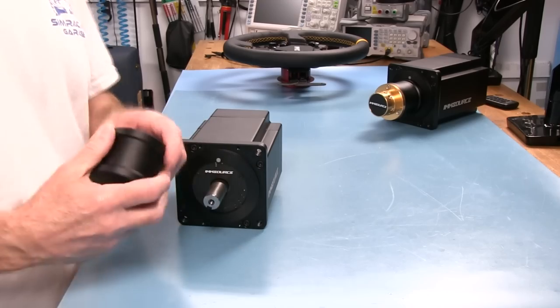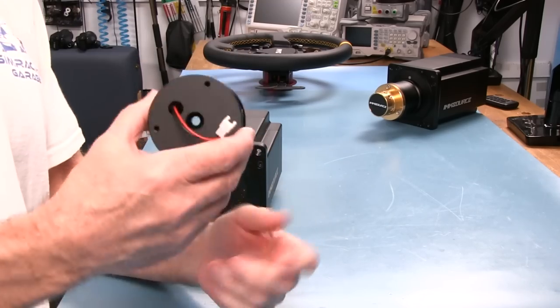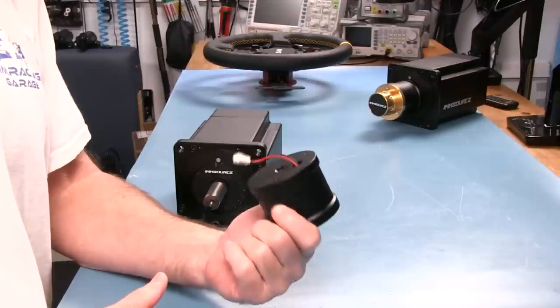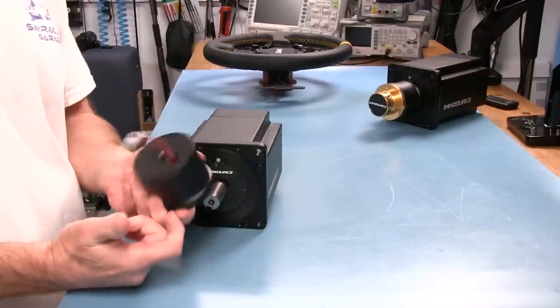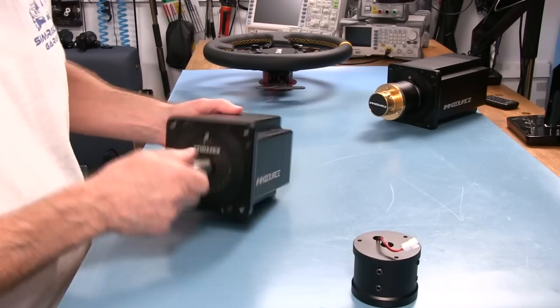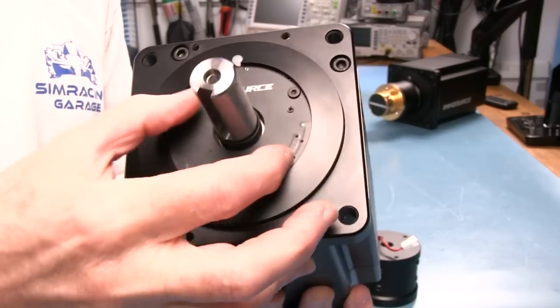That's three different coils before we get to the receiver coil over here in the wheel hub. So that's how they provide the power to the wheel. And I think it's pretty clever. I like the way they did that. It's pretty simple, and easy to maintain if you have to take this off and do some repairs to it. Maybe not so easy on this. It looks like we'd have to take it out. If I take these three screws out here, this plate may slide out.